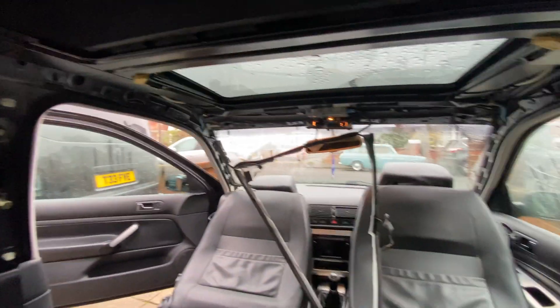And then as soon as I retracted it, it decided it didn't want to work. I've been looking around and it's quite clear, it's quite wet in and around underneath. So the sunroof seal is actually weeping and it's letting water pass. So yes, I do need to replace it, but I'm not going to do that now. It would make sense to do it now while all the headlining is out, but for £140 odd from the main dealers, it's a lot of money for that little bit of rubber.